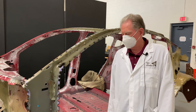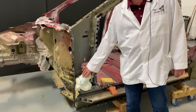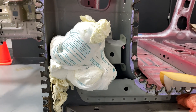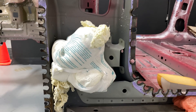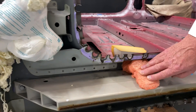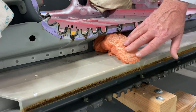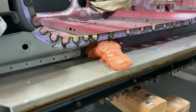Okay boys and girls, what do you think you just saw there? This is not what we expected to see from Tesla. We're doing the back tear-off now so we can get in to see the structural components of this car, and coming upon this thing was a remarkable — a remarkably bad find. Look down here: this is what it's supposed to look like, where the shape of the material went right around here on the rocker and foamed up and made a good bond.